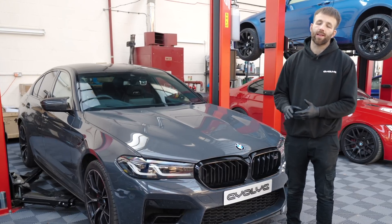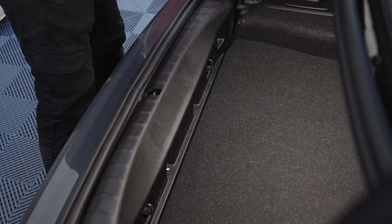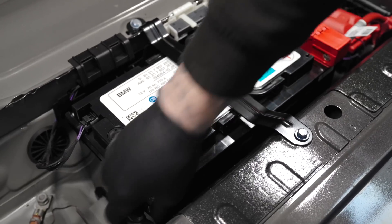the first thing to do is disconnect the battery in the boot. You may need a trim tool to hook underneath the carpet to pull the carpet up, as it is quite difficult to raise - there's no pull tab. Then you disconnect the battery with a 10mm socket.